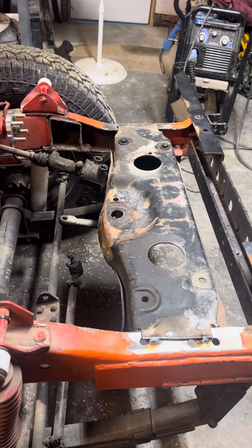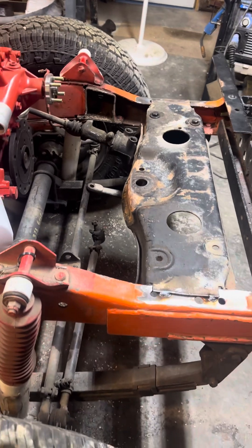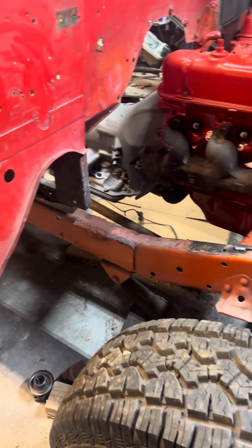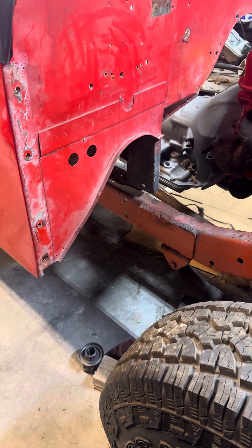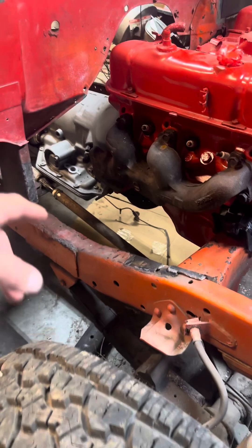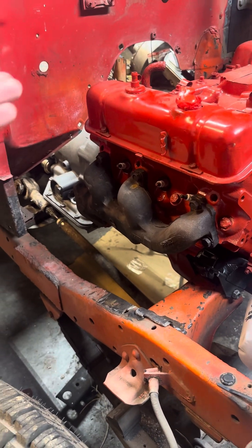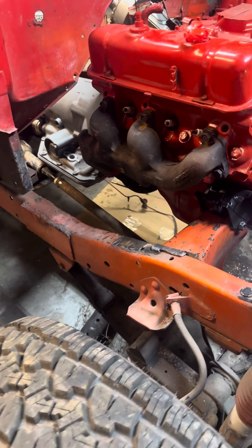There's lots and lots to go. As much as I love to say we're getting there, we are, but it's not just around the corner. We haven't touched the body really; we haven't moved the fuel tank, although that won't be too hard. The next phases are getting that axle on the right proper angle, getting the driveshafts fully done — the front one is just a temporary unit. We also need to make sure that with suspension travel there's no contact between the pan and the driveshaft.